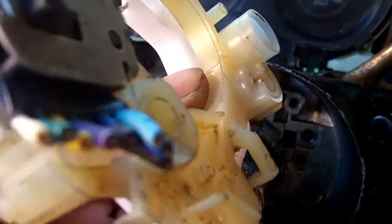Fuses are important — you don't ever want to put in an over-amperage fuse. I put a 15 in, which is what it called for, but it was cheap Chinese and didn't have quality control. When it went out, it took out wires, so I've got to fix all that and fix the switch.